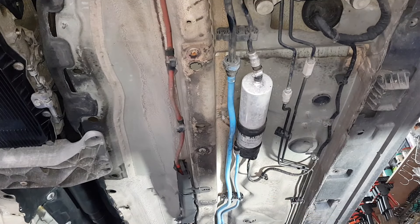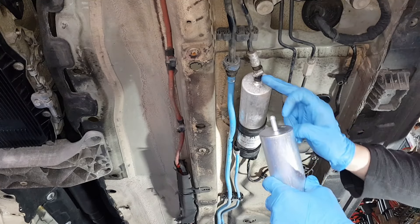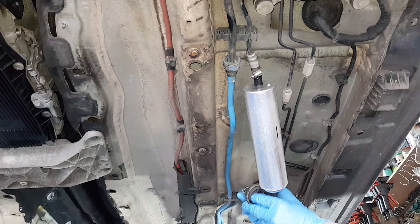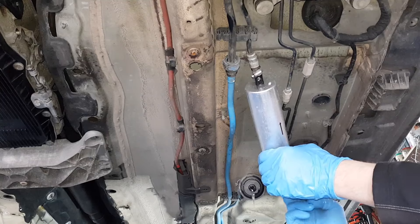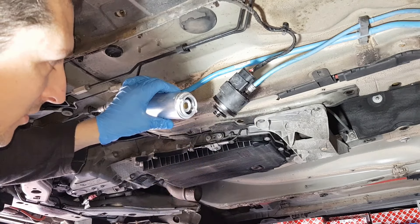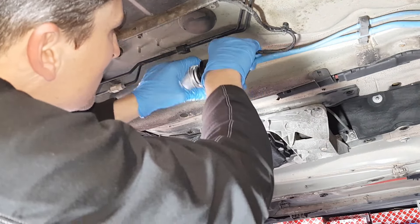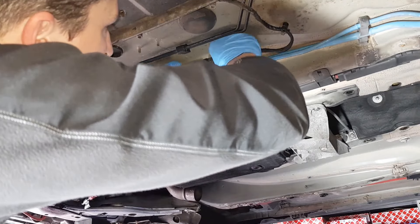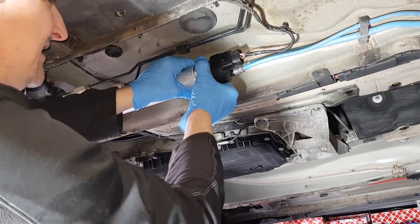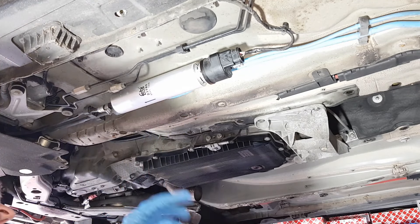Prepare the new filter — just follow the line, the direction of the fuel, the way it travels. When I disconnect this fuel filter, I'm going to connect the new one straight into the pipe. Place the O-ring on the new filter. There's another O-ring on the electrical element on the pump — wiggle it back in place. Push the clamp in place and wiggle it back and forth to make sure it's locked. Now place the bracket and tighten it up.